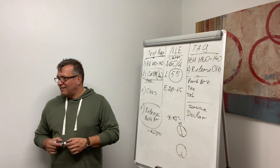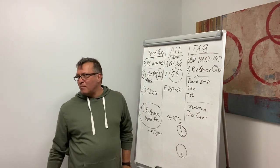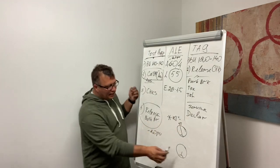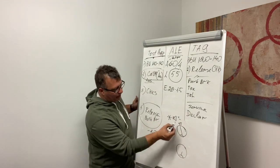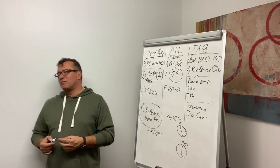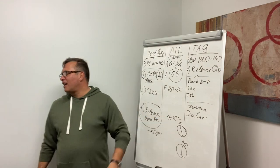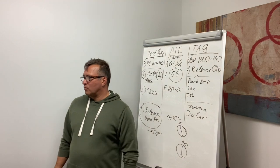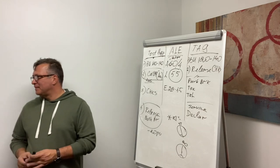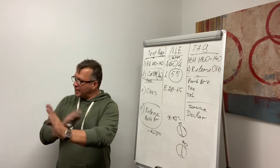You got a little bit of air pressure back. How? Because you've got secondary and primary. Primary is losing air first, using air from primary. Secondary goes after it, because secondary is supplying it. When it will be 55 here, it will be something like 60 here. Not much of a difference, but it's still a difference. So after you see buzzer and light, do a couple more pushes, like one or two. Make sure that secondary is there somehow. Okay, or if it happened, just hit a couple times and say, okay, secondary is supplying my head.